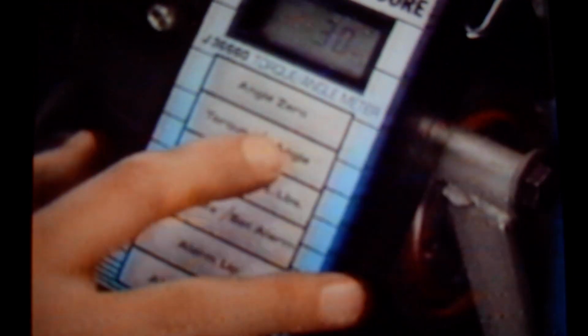When all bolts have been tightened to threshold torque, the meter is placed in the angle mode. With the sensing head on number 1 bolt, the anchor clip is attached at a suitable location. This ensures the sensing head does not rotate when the bolt is turned. The angle 0 button is then pressed, and the bolt is slowly rotated the specified number of degrees. Again, the alarm sounds when the preset angle is reached. The same procedure is repeated for each bolt in the proper tightening sequence.